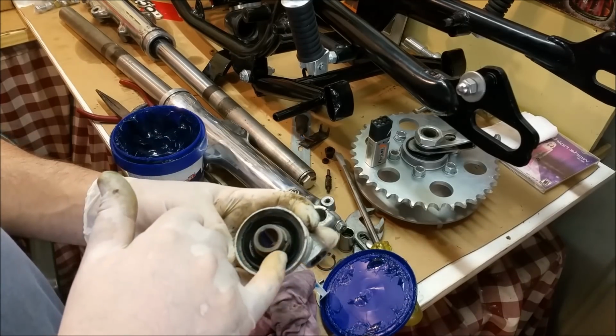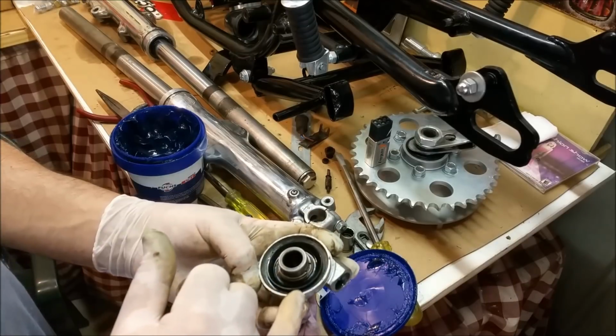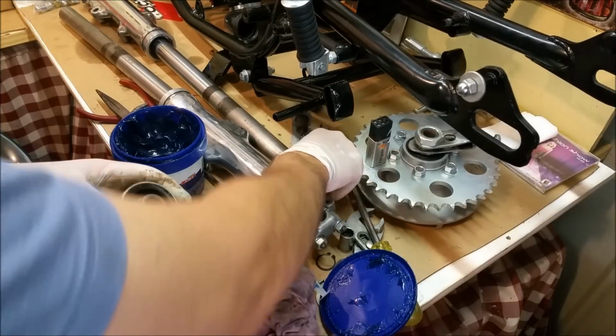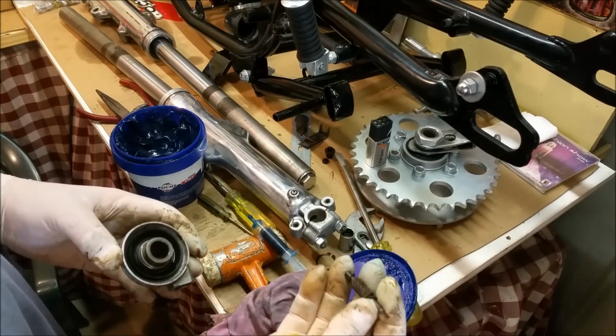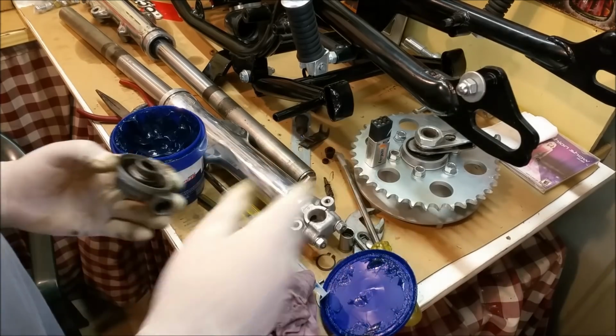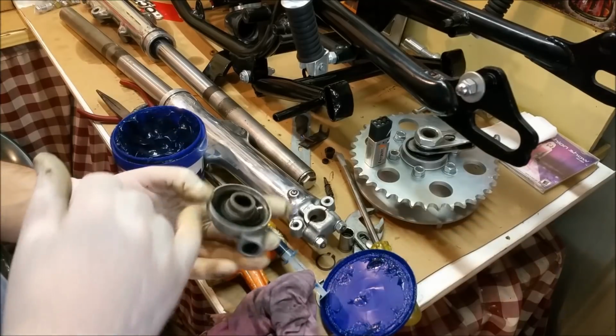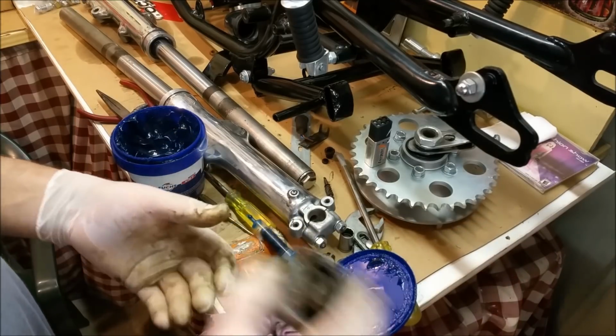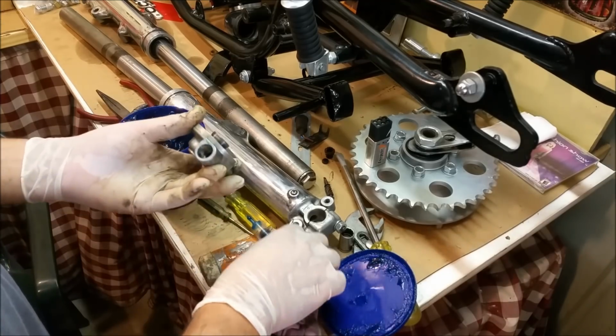There's a complicated seal. I've tried to get it out gently. Not going to budge. This turned well. This wheel here, the little worm, was pretty mucked up. Ideally I'd like to pull it apart, but I can't get into it without destroying the seal, and I couldn't find one. I've soaked it in CRC, stuck my thumb over there, shaken it, poured it out. Done that a few times now.